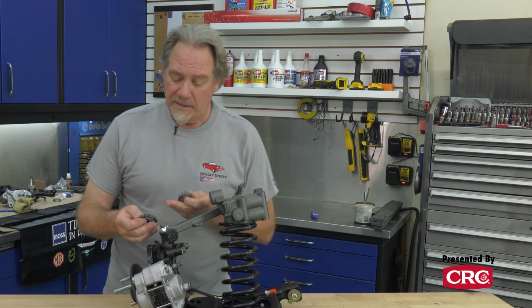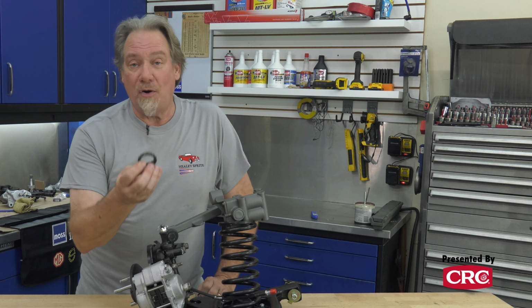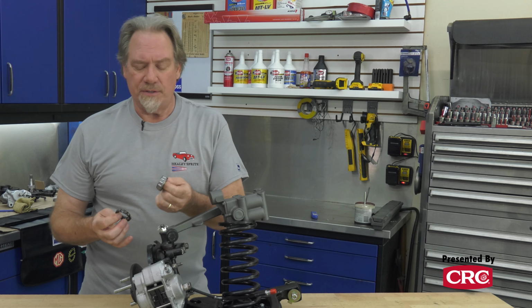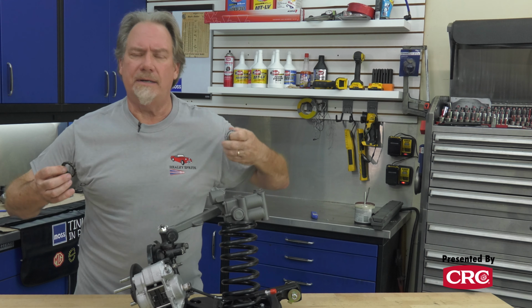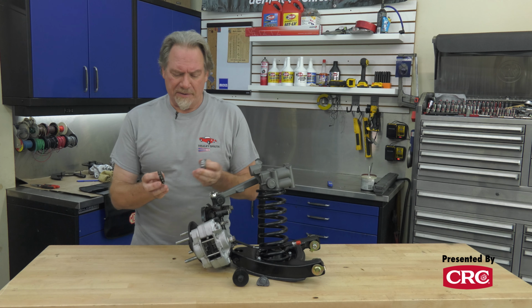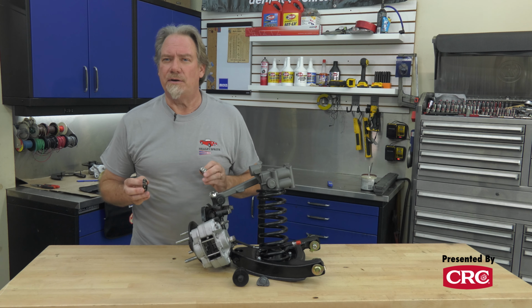The other thing we've done is switched from this truly archaic ball bearing type system that an original Sprite hub uses to this tapered roller bearing, which is a much more modern system, which certainly would increase bearing life and also reduce the play back and forth and make it a little easier to set these cars up.